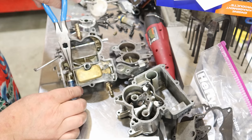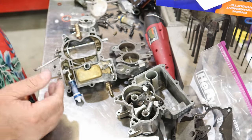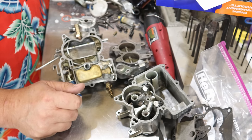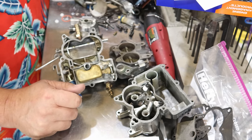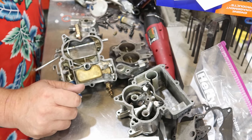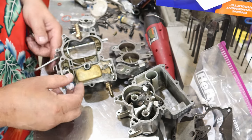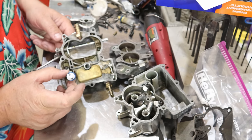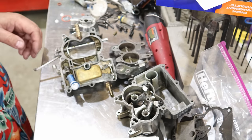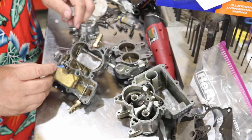We're just gonna pop that on. Accelerator pump. Now they call it, I call it accelerator pump. Just looking here. Pump inlet screen, pump place. They just call it a pump. I call it accelerator pump because when you give her the onions, it squirts a bunch of raw fuel down the throat of this thing and gives it the power to launch without having a dead spot. Okay, now that all this is installed,